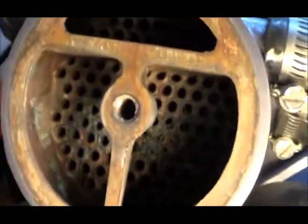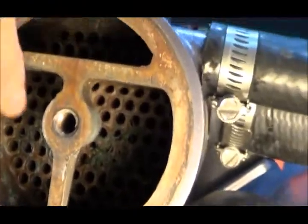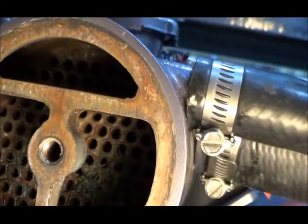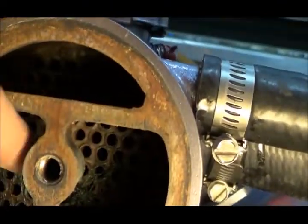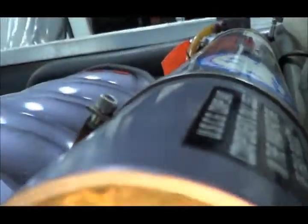Both times I've taken this apart, I've found quite a bit of gunk at the turnaround. So the river water turns around and heads back down this way, and the upper compartment here is completely separate from the lower compartment. Back at the inlet end now, we're looking at the bigger compartment. The water comes out of the middle set of tubes into the bigger compartment, then turns around and heads back down that way through the top three rows.